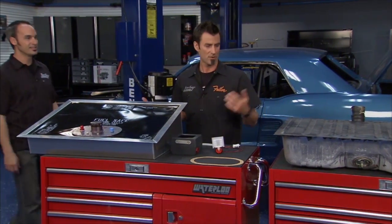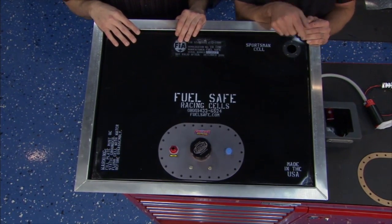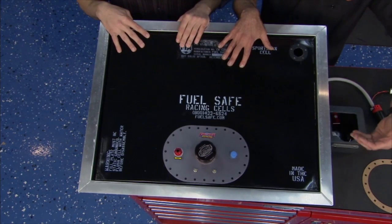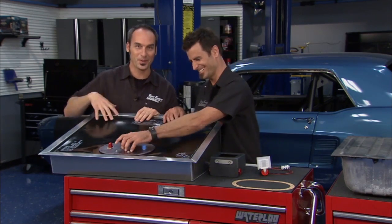Back in the day, not a problem for a street car — still a good tank for a street car. But we're going to push this thing: go left hard, go right hard, go forward hard, and we're going to be in some dangerous racing situations. So we're going to switch over to a fuel cell. The big difference is it has a bladder, so if you get a side impact, in the old days it would just shear the metal, pour gas everywhere, catch on fire. That's not a fun situation — the tank is right in the back where you can spin out, crash into a wall, or get hit from behind. A fuel cell is a really good way to upgrade your safety.